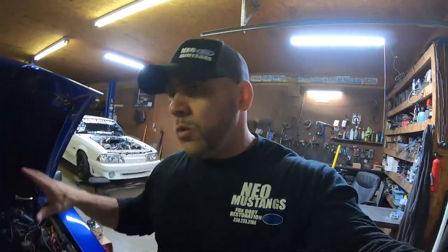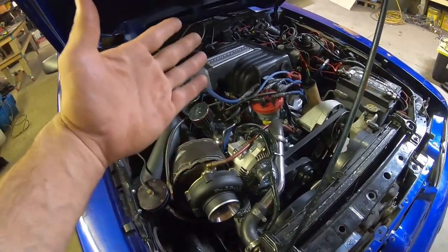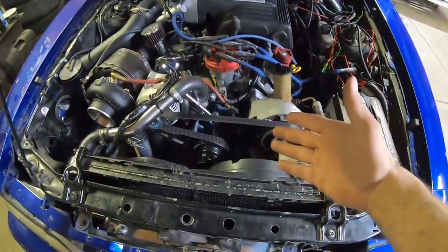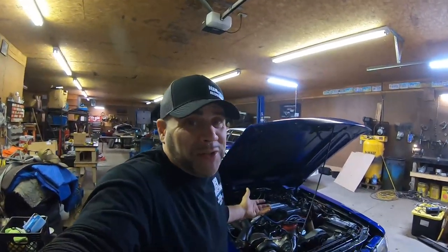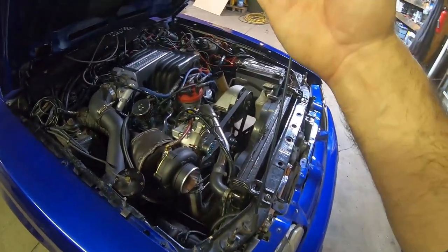We're here to talk about what's next with dad's car. The biggest problem we're having in this build is the fact that our injectors are pretty much out of fuel. When we were running a bone stock motor on the A-trim with the Kenny Bell FMU, AFR ratios were in the high 11s — with 19 pound injectors we made 335/380 wheel. But as soon as we put the turbo kit on and a whole other motor in, things started getting crazy. So our options are: switching to a mass air meter, going to a Terminator X, or doing some binary editor tuning.